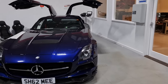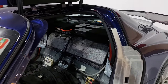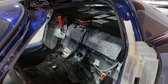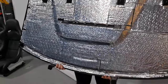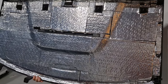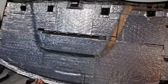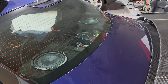So just going to be showing you guys the actual panel that sits on the rear shelf. As you can see here, this is the rear shelf where the subs and products are sat at the moment. I'm going to be walking you around that in a little bit and showing you exactly what the products are and how they've been installed. What we've got here is the back of the panel that used to sit on the rear shelf. This is a three-layer acoustic soundproofing skin, basically stopping all the resonation and rattles you're going to get from factory panels in the vehicle. However it also reduces a little bit of the road noise. So that panel actually used to sit covering the subs and the amps, which I'll go through in a little bit.